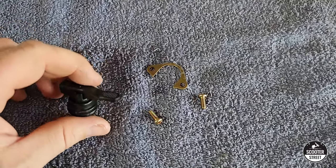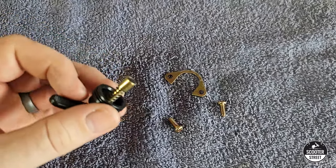In my opinion there's another easier method of diagnosing auto choke problems: replace the auto choke with a manual choke and see if the same problem manifests. The reason this is easier is it doesn't involve putting anything in the freezer — it's literally two bolts to replace. Because you can operate the choke manually, you can be absolutely certain whether the issue is the auto choke not functioning properly or some other issue with your carb. We have our shop Piaggio Zip behind me and I'm going to show you how to replace it — it's very easy because these have an access panel under the seat, so you can get to those two screws that hold the auto choke from under the seat. Honestly it's about a 10-minute job.